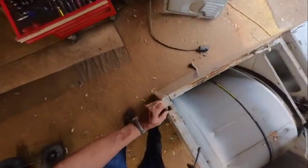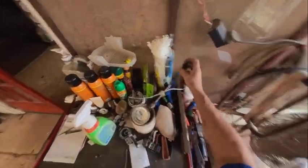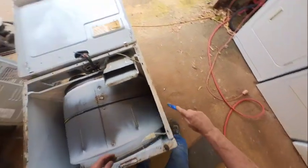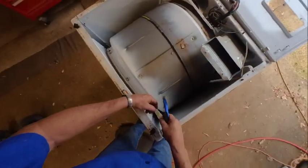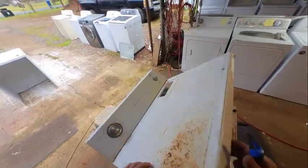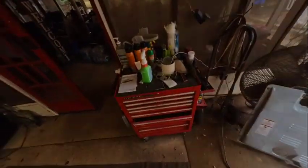Then I plugged in the door switch — it was a good door switch, but the little plastic clips on top were kind of boogered up. I got them back in line, but I'm probably going to have to wind up changing those because they don't hold the cabinet top down like they should. I took a brush and brushed all the rust and dirt off the top edges. I still had to fix that ground wire — all it does is connect a ground to the cabinet top so that if something happens, the consumer doesn't hurt themselves.